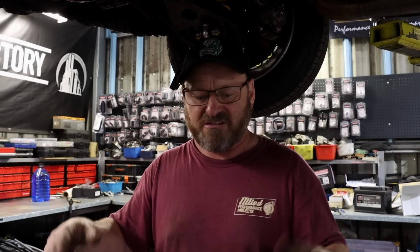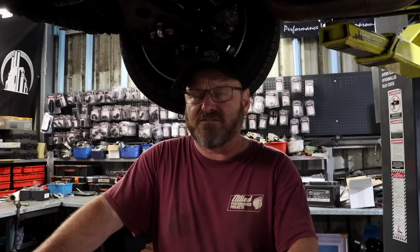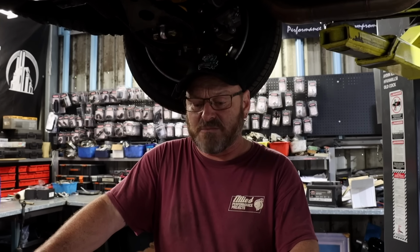They come in Presidents and other things too, yeah? President, Q45, whatever, wherever you live, and 350, 370 Z, a bit different to this, but same sort of diff. So not great ratios. They don't go up past 3.7 as far as I'm aware. So if you've got a high revving buzz box like an SR20 or something that needs to rev its brains out, then they're not much use for that.